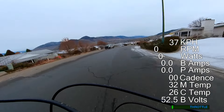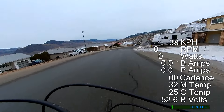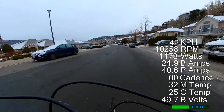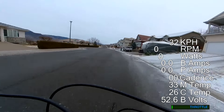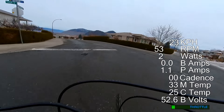What I'm really interested in is, using an external controller, can you run PAS at a more sustained level — say 750 watts, 800, 900 watts continuous? I found that 500 watts was the sweet spot for continuous running, and that was over a 35 kilometer route that I took with a lot of climbing still.